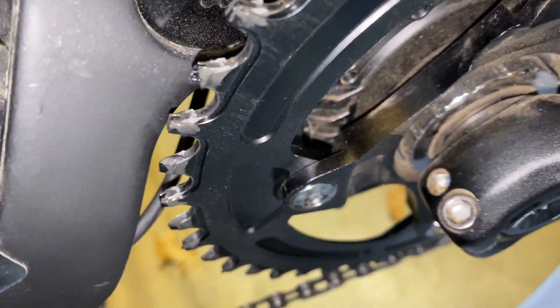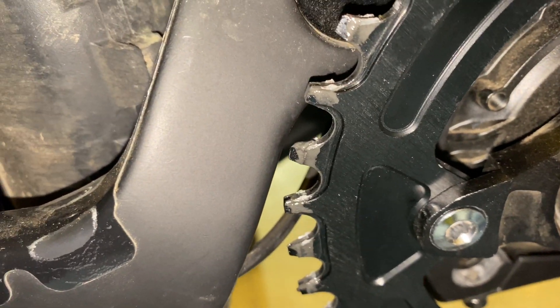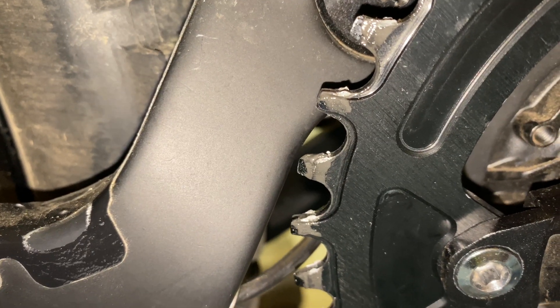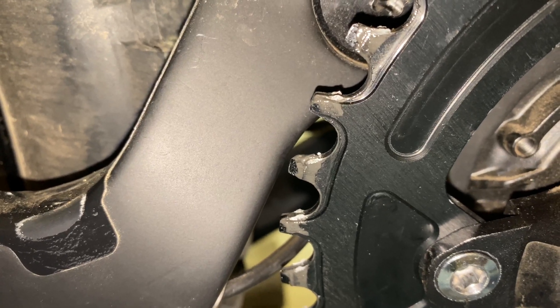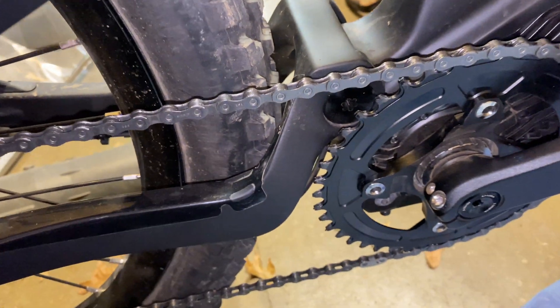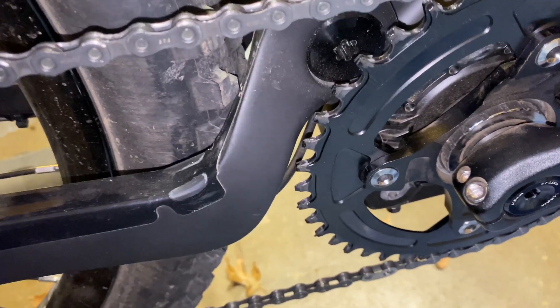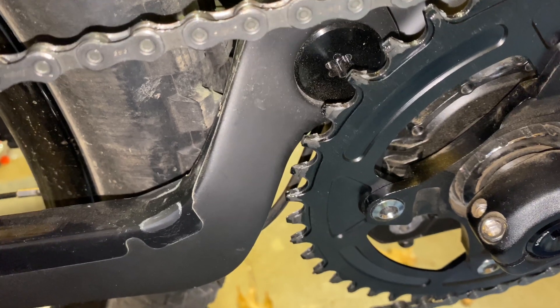Although I am considering running a 40 tooth just to be safe. I don't want the chainring to dig into the chainstay and start a crack. There might be a situation where I'm going up a really steep hill and using full motor power. If the swing arm goes up it'll move away from the chainring, so you don't have to worry about the suspension causing it to get any closer.